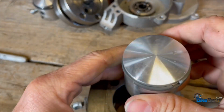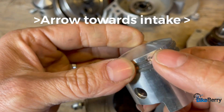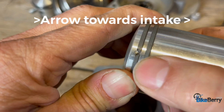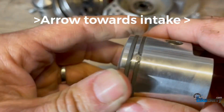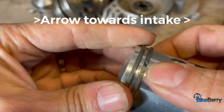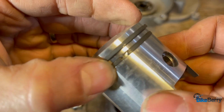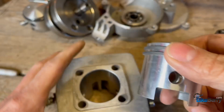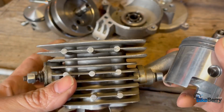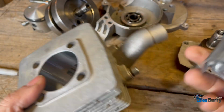And then the next thing is to make sure that this was oriented in the right way, because these have these little pins on here, right? That way everything lines up really well when your rings are in place properly. Sometimes gouges and scrapes can happen because those things are more in line like this and get smashed in there, right? Or they break, something like that can happen. And one thing that we do sell, if the whole upper assembly gets trashed, then you can order a whole new upper assembly. That way you're not replacing the entire engine.